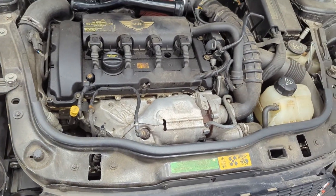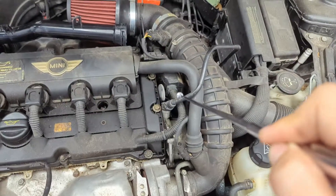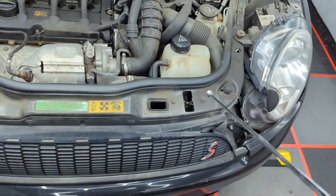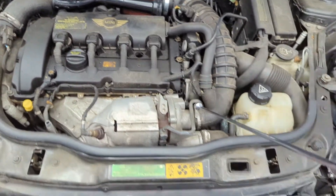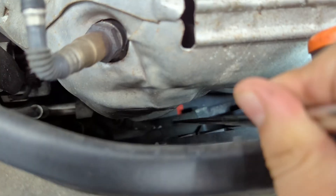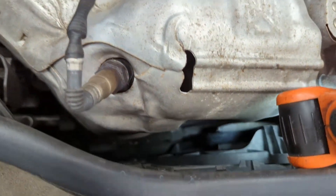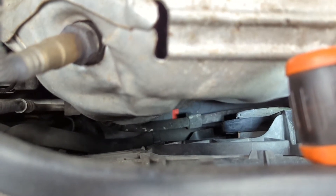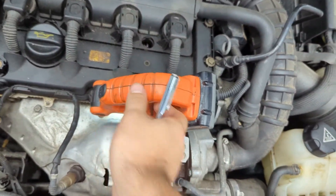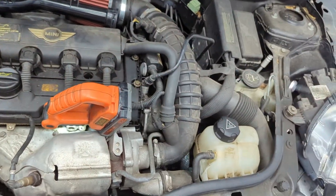Those are the four major components of the cooling system on the R56: your water pump next to the block right down in your wheel well, your crossover tube which is very unique, your thermostat housing right down there that looks like an artificial heart, and then your coolant expansion tank which we're going to replace right now. If you're doing any coolant work outside of the expansion tank, you've got to drain the fluid. The Mini Cooper does not have a drain cock like most do on the radiator — it's just a hose underneath. You disconnect that hose right there on this side and you drain it. It's very unconventional but there's no drain plug. Also, you have to use European blue fluid because Mini Cooper — it's a little more expensive but most auto parts places do carry it.